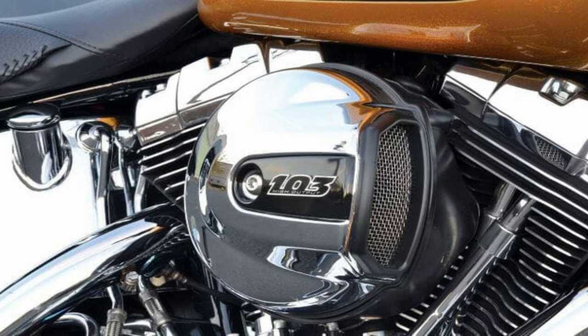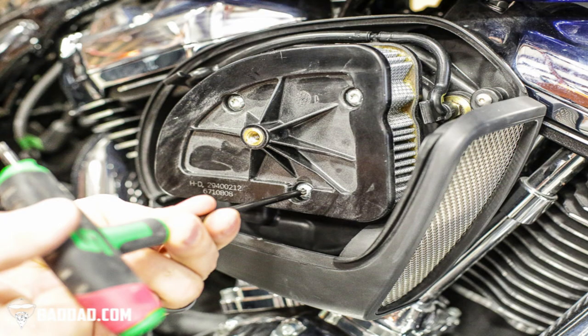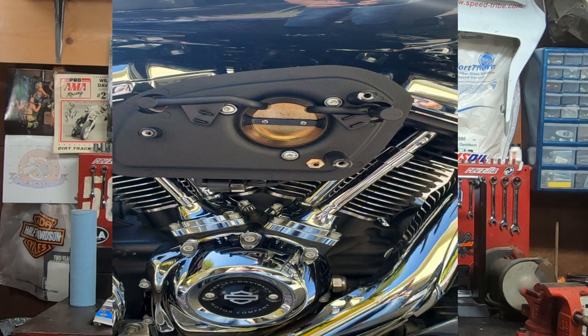When bikes come from the factory, you get a choked-off air box on just about any new Harley model. Harley has gotten better in later years — they started doing this with the Twin Cam 103 HO at least on the Softail and Dyna models — giving you more of an open element air cleaner, though it still had a paper filter. But if your factory bike didn't come with that, you had a gnarly choked-off air box with a little snorkel that the big V-twin is supposed to pull air through, satisfying EPA requirements for noise but really making a bad situation worse.